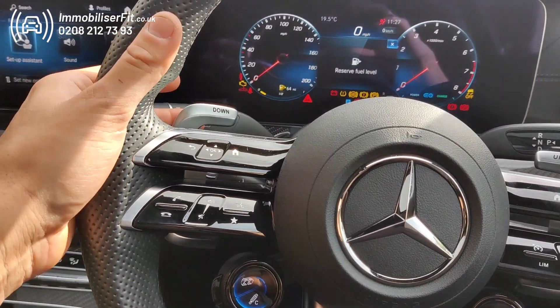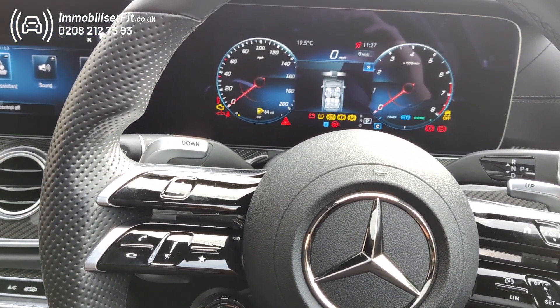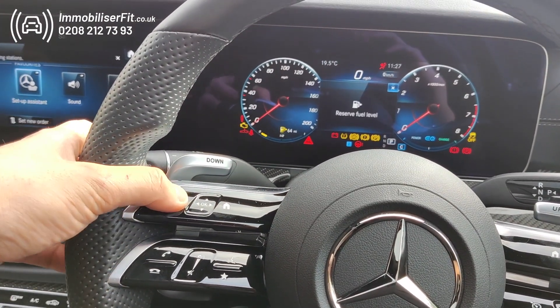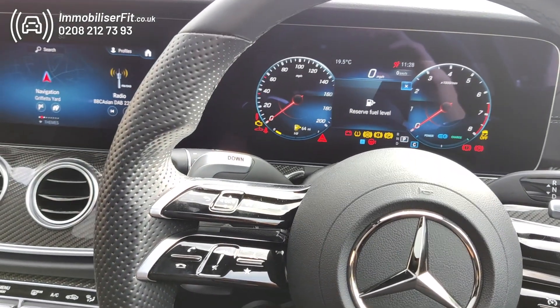Once it's disarmed, enter one, two, three, four, five on any button you know works, then ignition off and back on — five presses. You can change any button. This can be between three and 21 presses in any order. For the video we'll keep it simple — three presses.